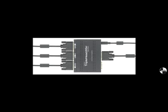The digital edition of the Matrox TripleHead2Go offers several improvements over the original analog version. The first of these is a full digital signal path from your video card to monitors. The lack of a digital signal path was one of the major complaints levied against the original version. Seeing as how the digital TripleHead2Go requires a dual-link DVI signal, we now have a better understanding of why an analog signal was used in the original version. The digital TripleHead2Go still offers an analog input option for users without a dual-link DVI graphics card.